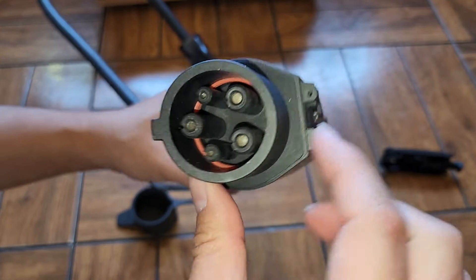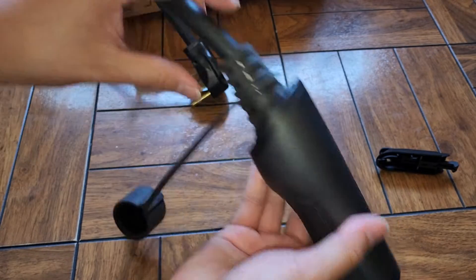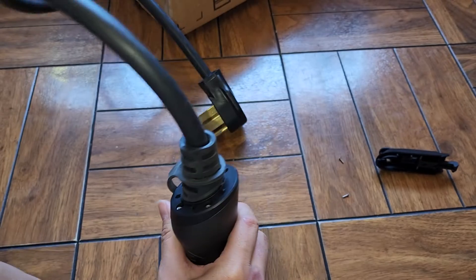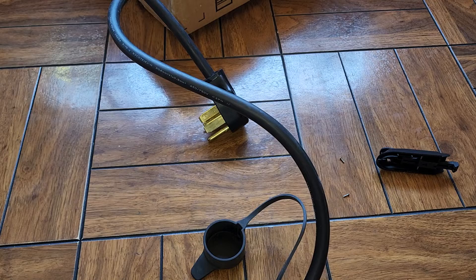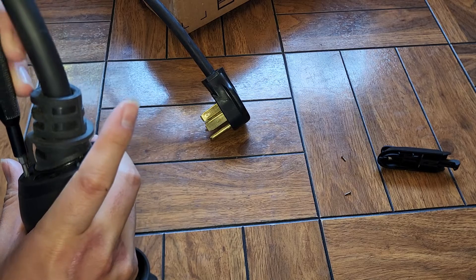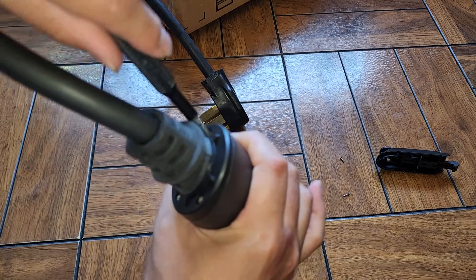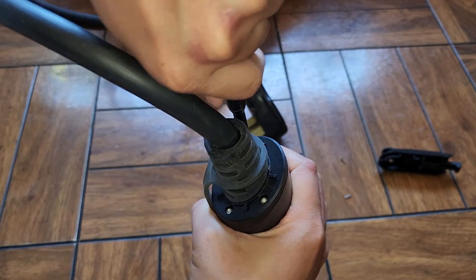There's a seal in here. I don't see any screws on the side either, but there are screws on the back here and these do use another special type of screwdriver. This is probably like a T8 or T9. Let's try with the T10 first. Yeah, I think it's a T10 — the next up is T15 which is way too large. So let's go ahead and remove these T10 screws. There are four at the bottom if you didn't notice.